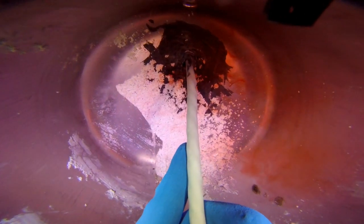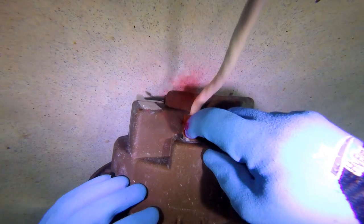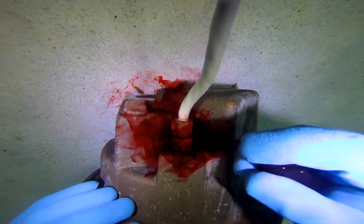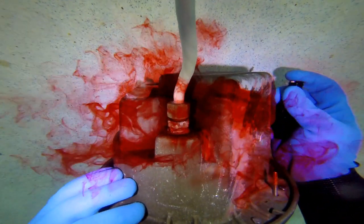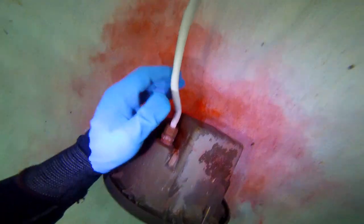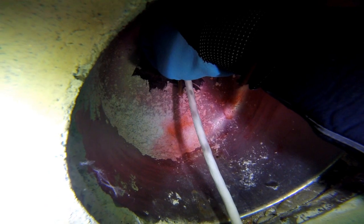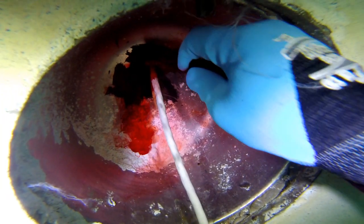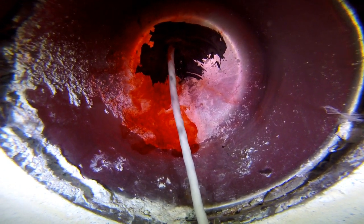I want to be careful about showing you exactly what I was looking at, because these leaks are not always obvious. I'll also test the connection to the back of the light itself, because it's possible that water could be walking up that wire and going out. But I don't see any dye getting sucked up there either. The only thing you can do is drop the dye and try not to move it around too much — you've got to move nice and slow and just watch. It takes a tremendous amount of patience. The dye isn't getting sucked up there either.